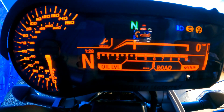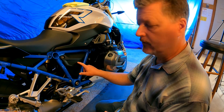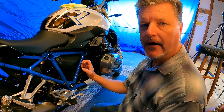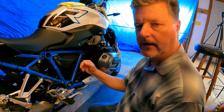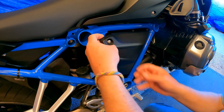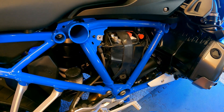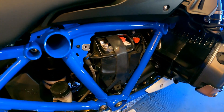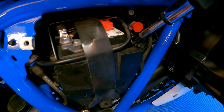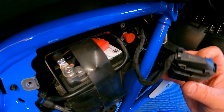With that in mind, let me show you how to do the service indicator reset. On my particular bike, the connector is located behind the battery cover. Let's take the battery cover off and get to the connector. The connector has a little clip that holds it in place — if we get behind that and push the clip, we can pull it out for easy access. This is a T25 Torx on my particular bike, just one screw. Once the cover comes off, right here beside the battery is my connector.